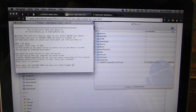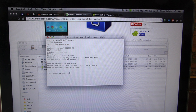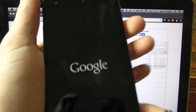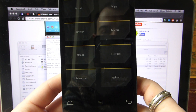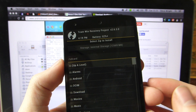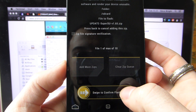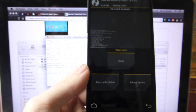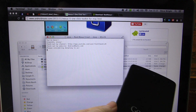You can see it says 'Ready to install TWRP recovery. Press 1 and then press Enter,' and that will send the recovery across. We're going to key down to recovery mode and hit Power. Then you see Team Win. We're going to go to Install and go all the way down to the update SuperSU version 1.65 folder, hit that, and swipe. You'll see it says 'Successful.' We're going to hit Reboot, then hit Enter, and as you can see, we are now done.